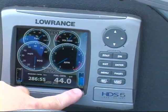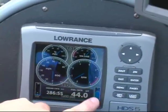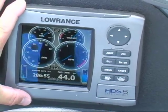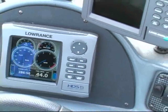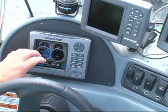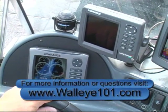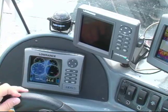Small issues — I can get them fixed before they turn on a buzzer. Remember, warning buzzers or what we call idiot lights go off when you've already got a problem. Being able to watch these parameters gives you a chance to see a small issue develop before it becomes a problem and get it fixed. You have the ability with a small cable through the Lowrance network to hook this up — you can overlay this data onto a regular sonar GPS screen or use a dedicated unit. I would definitely suggest if you have an HDS unit and you have an Evinrude E-TEC, a Suzuki, or a Yamaha motor, get the engine interface cable, hook it up, and have the ability to see these parameters — see how your engine performs, get the best gas mileage, and keep an eye on your engine. Try this network engine interface cable on your Lowrance HDS — really cool feature that allows you to get the most out of your boat and be safe.